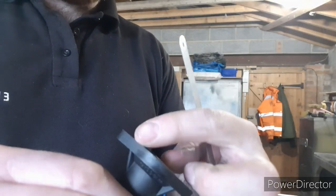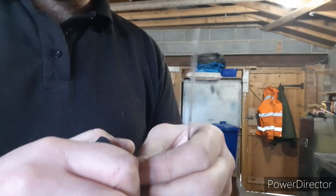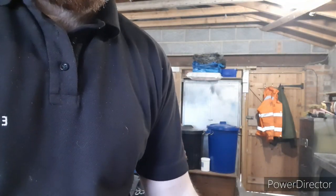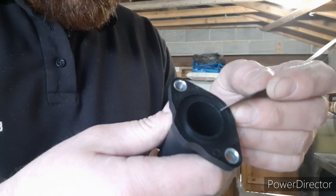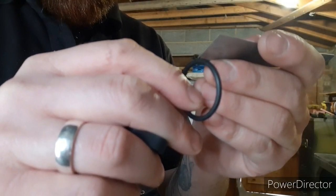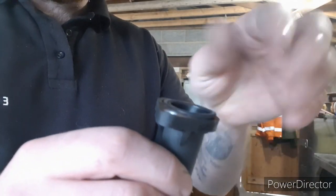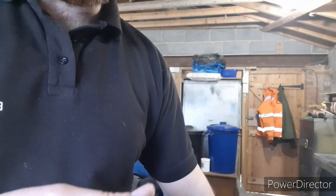Pull the O-ring out. That O-ring is the wrong size for that recess. If I take it back out again and measure it - recess-wise we've got about 3.5mm, and the O-ring looks like a 2mm O-ring. So you've got a 2mm O-ring and a 3.5mm gap - they clearly don't work. When you put that in there, you've got too much space in that recess for the O-ring to seal against the head.